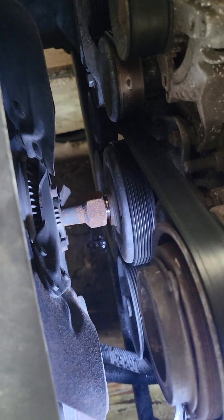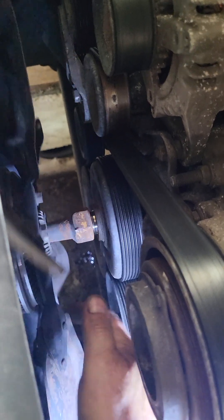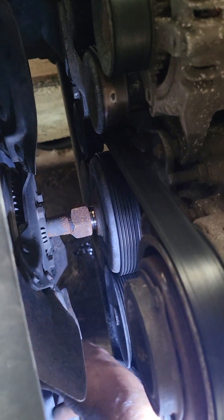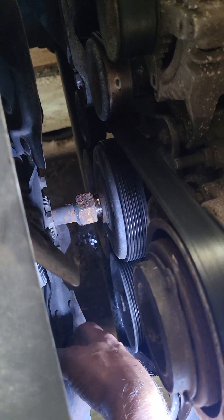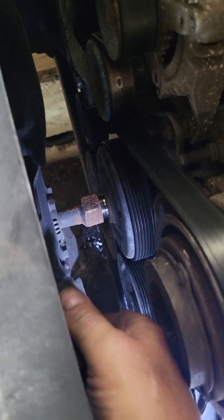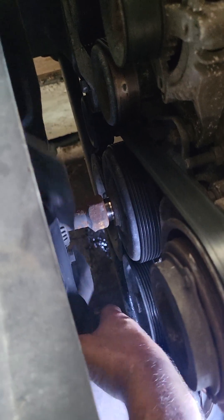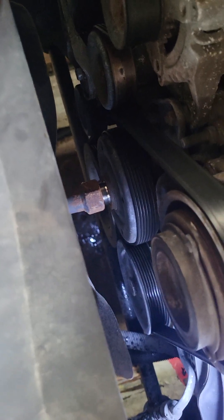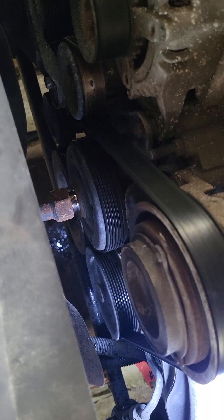When you spin this off, be careful — don't drop it. A steel fan blade can damage your radiator, as the radiator core is most likely aluminum. You don't want one of those fan blades to damage one of your cooling tubes on your radiator — it'll knock a hole right in it, and then you're going to have to put a radiator in, which is more money and more expense, and the customer is going to be mad. Anyway guys, thanks for watching — share, like, and subscribe, and comment if you will.